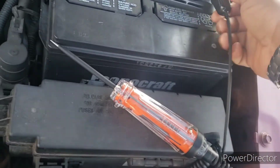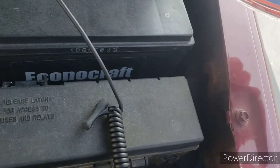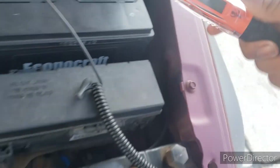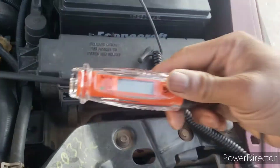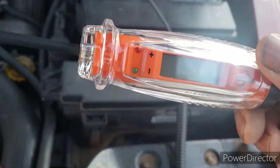Which is pretty good to know. So I put this back on the ground like it's supposed to be and then touch this. See, it lights up on the red light — 12.6. Tells me it's the right polarity. This little thing is great.